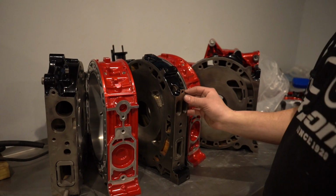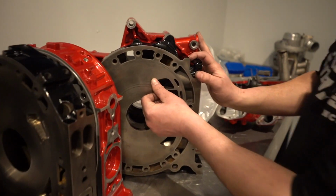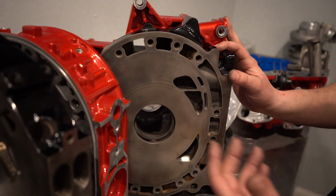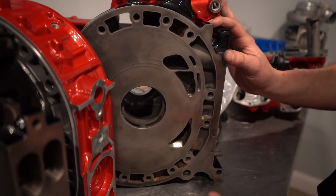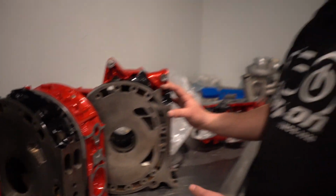So we're gonna check that out, see what that does, because everyone's like, but why? Why? The exhaust ports are already limited. And I'm like, okay, fine, the exhaust ports are limited. Let's see how limited they are. So right now I opened up the intake just about as far as I can. We can do a little bit more up here, but we're going to double check it anyway, because if it doesn't make any more in a street port, then there's no reason to go any further if we're limited at the exhaust. So we are going to be running 3 EGTs as well, just to see where we are as far as the exhaust temps go.